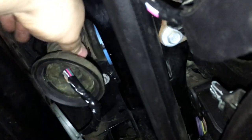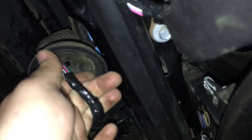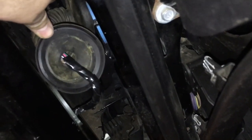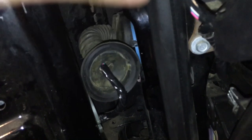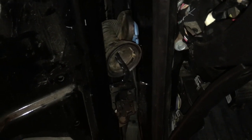You can see the gray wire there goes through over into here, so pull these off and you'll probably find a frayed wire. In this truck it was a green wire. Same thing happened to my dad's 2010 Denali — a different wire, but kind of both had the symptom where the door was wide open and window switches wouldn't work, but shut the door and the window switches would work again. After tearing everything apart and figuring everything out, it was just a broken wire in here.